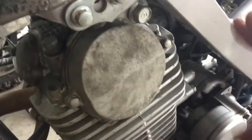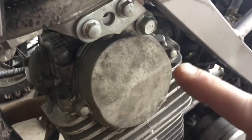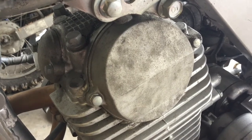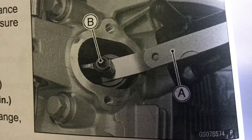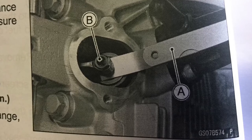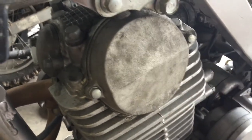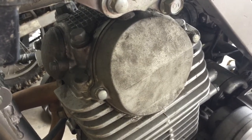So that's where it has to be — right out of the service manual. Once the covers are off and you've rotated to TDC with the mark, take your feeler gauges and check your clearances. If you don't know how to do a valve adjustment with tappet valves, I'll leave a link in the description to a good video on basic instruction. He's working on a Honda so some things like the direction you turn are a little different, but the actual valve adjusting part is universal.